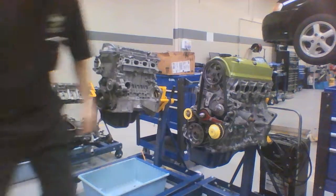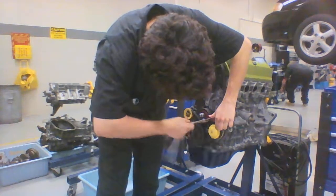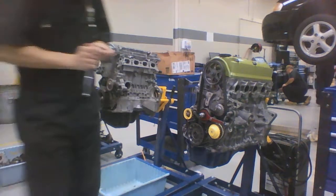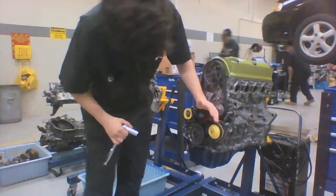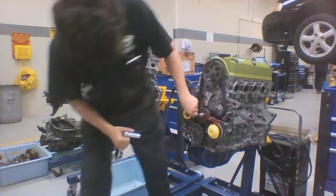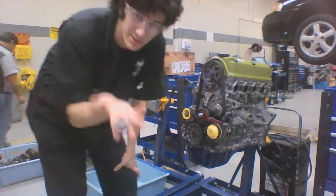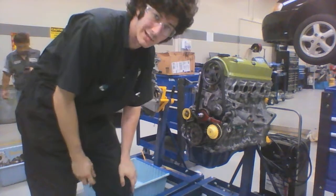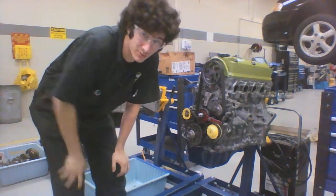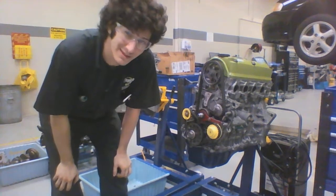Now you can go ahead, move over, and adjust your tension however you would like it. Go ahead and lock down your bar, use your hand to push down, and tighten up your tension so that way you have nice tension on all your belts. And last but not least, you must put on your crank bolt, or else this could just slide right off — and then you've done all this for nothing. Chances are you're eventually going to come out of time, because this is what also holds this belt from sliding off as well. This has been John with JTEC. Hope you learned a little something about the timing belt. See you next time.